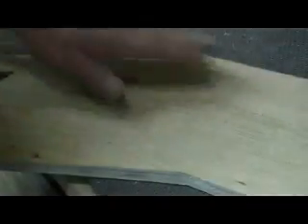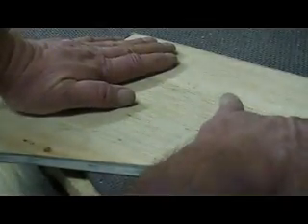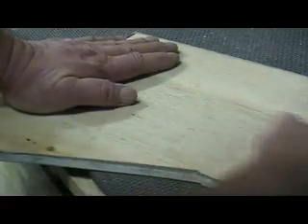See what I'm taking off? It's just like a flaky powder. When you sand this cloth you actually get in there and cut the fibers — this doesn't do that. I wish you guys could feel that — it is just as smooth as a baby's bottom and pretty much pinhole free. One coat of primer, sand it, another coat of primer, sand it — that's ready to paint. No pinhole filling.